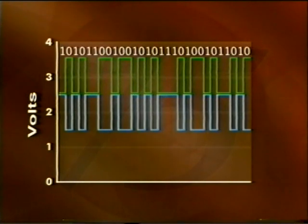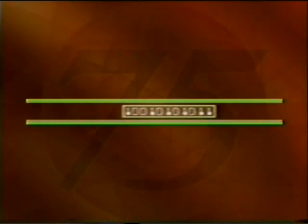In this way, a digital signal can be transmitted by the ECU containing a stream of zeros and ones. In computer terms, a zero or a one is known as a bit of information. The CAN bus is capable of carrying half a million bits of information every second. By stringing together a minimum of 44 bits to a maximum of 108 bits, a message is formed.